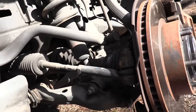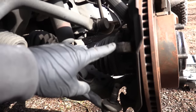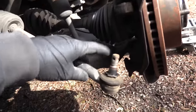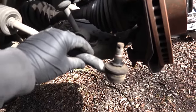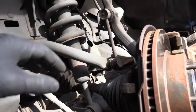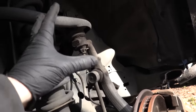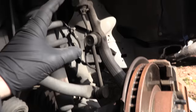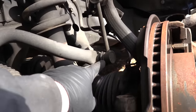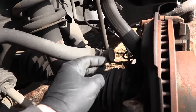I had to use quite a bit of force with a hammer to loosen this up — a couple of taps on the top — but be careful, it will take some force. Next, the sway bar is attached to the knuckle and we need to drop the knuckle down, so the instructions say to disconnect the sway bar here. I'm going in with a 17-millimeter bolt on the back side to unbolt and pop the sway bar linkage out.